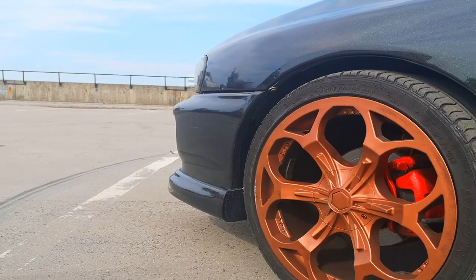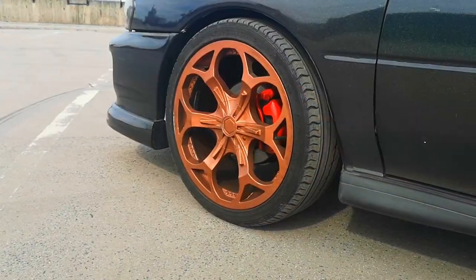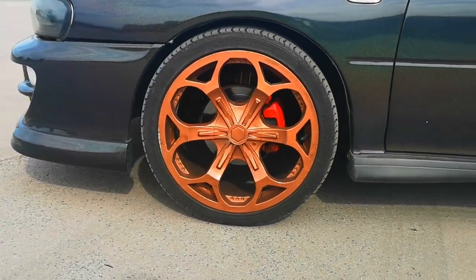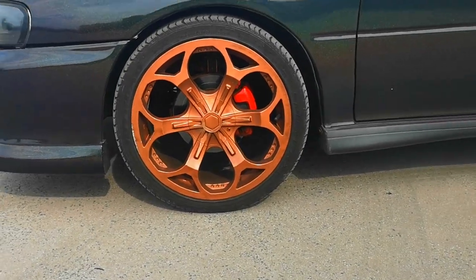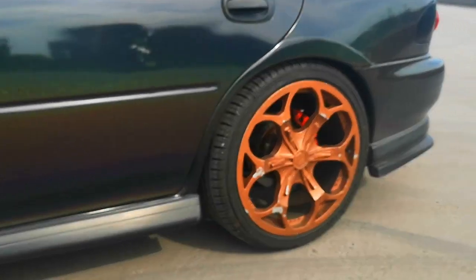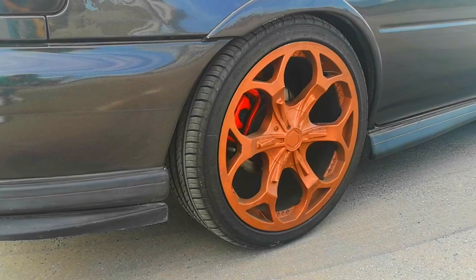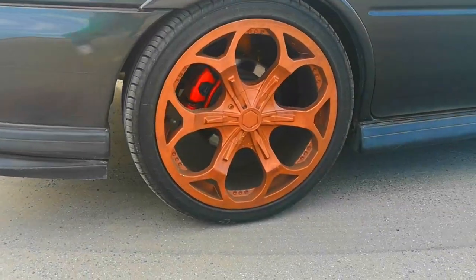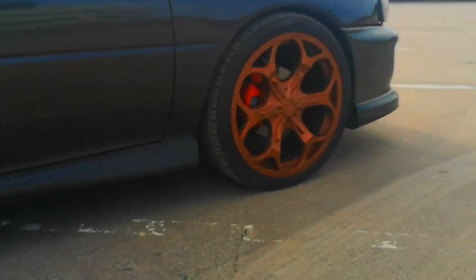My alloys are 18-inch Wolf Race wheels sprayed in bronze — they will be powder coated though for next year. The tires are Sport RX6s 215/40/18s. The front calipers are from an SG5 Forester running Brembo discs and pads. The rear are drilled and grooved Brembo discs and pads, and I've painted the calipers all red. I want to upgrade the brakes as soon as possible for better stopping power — four-pot calipers in the front and two-pots in the rear, that's what I want to do.